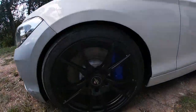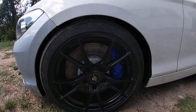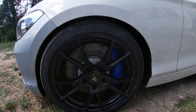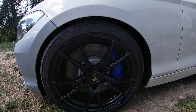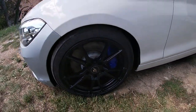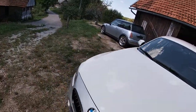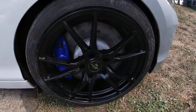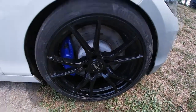Here we have it. The fronts are bled, all tightened up. The two 18 bolts you tighten up to 110 Nm. And of course the hoses — the lines, whatever you want to call them — you just tighten up by feeling. And no, I'm not doing drugs. It's allergy season and I'm dying.